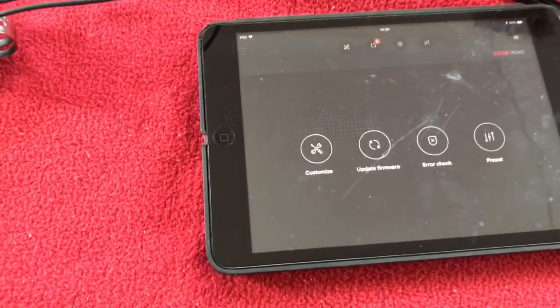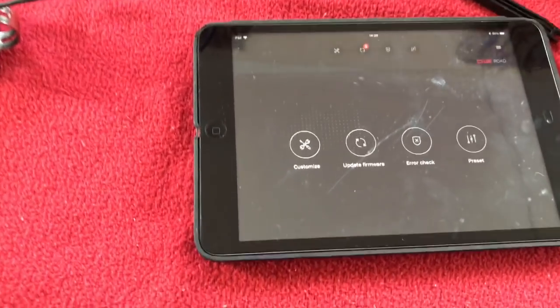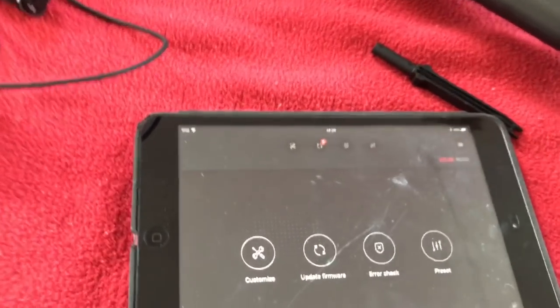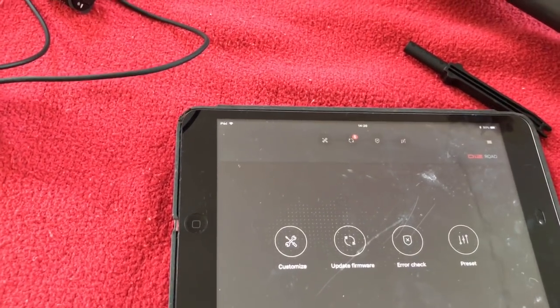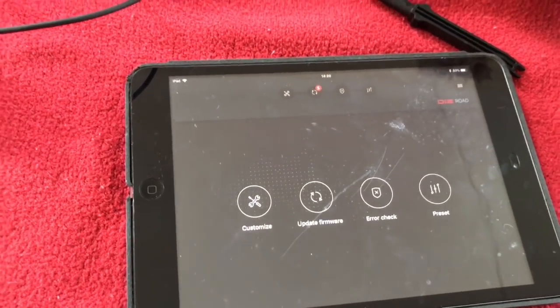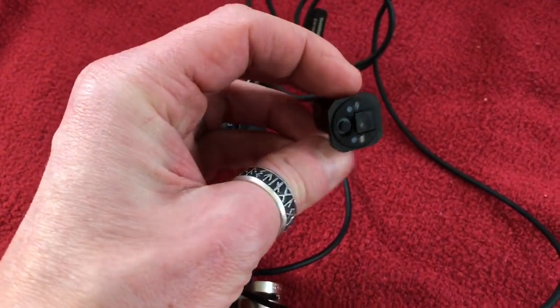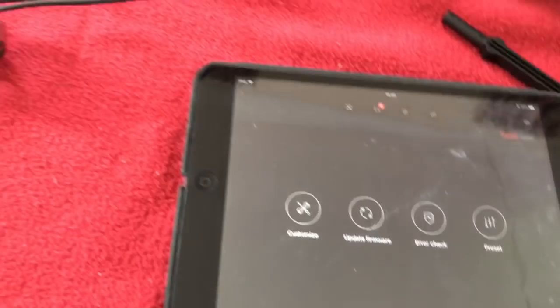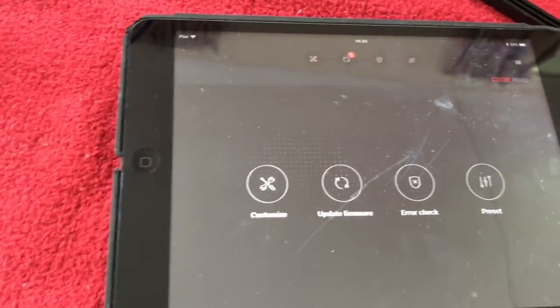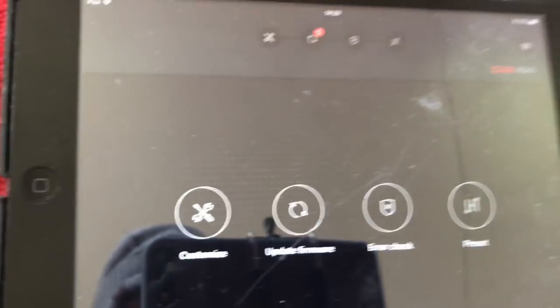As you can see, we're back. I was right - it was an error with the iPad. However, after that error I couldn't do anything with my Di2. Levers didn't work at all, the buttons didn't work, the junction A didn't work - I was getting a bit scared. So what I did was disconnect the battery and reconnect it. That lit up. I then used my phone to update the firmware and it took about 70 seconds and it was done. I've put my iPad back on and this is what we've got.